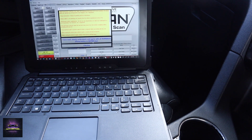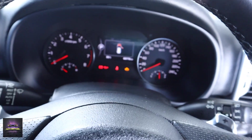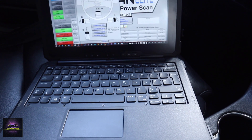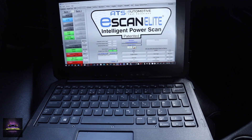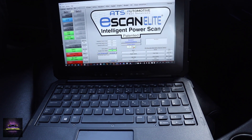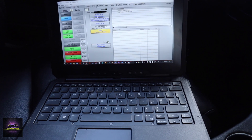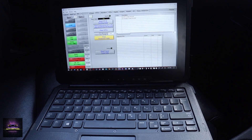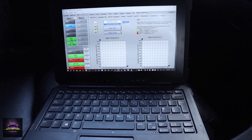It sounds like it's lacking something. The dash shows about 68,000–69,000 kilometers. Let's set this up, check the fuel trim correction — that looks good. Narrow-band sensor reading looks good too. Let's scan for codes and see if we have anything that can help us. We have no codes at all. Let me use the SharpShooter and do a compression test.